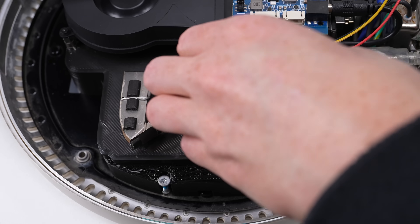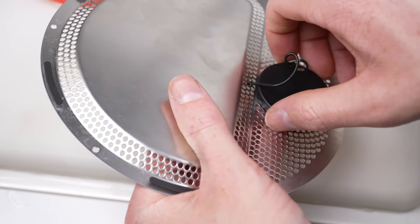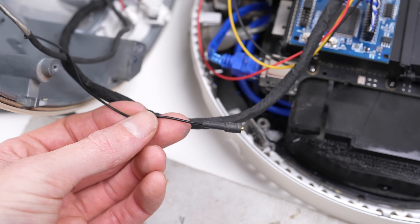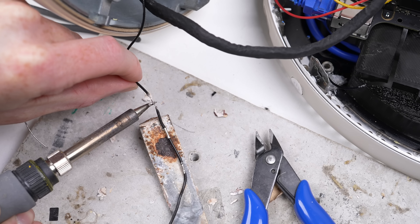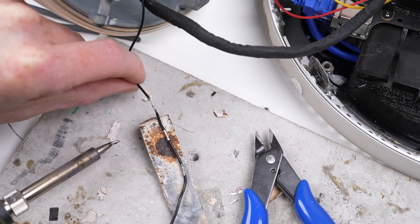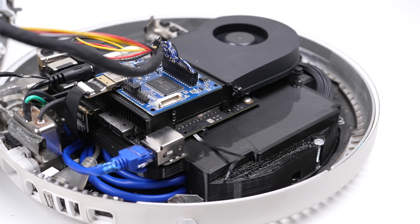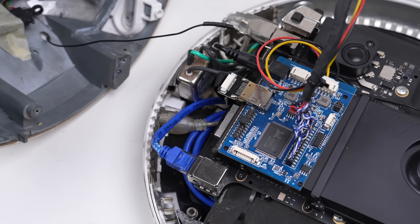The Wi-Fi antenna proved not so easy to remove. I thought it was screwed into place, however it turns out it was riveted - when I pried it apart it tore the cable right off. But fear not, the iMac has one built-in antenna, however the plug differs from what's on the Mac Mini. I can cut the old connector off and solder on the cable from the Mac Mini Wi-Fi antenna. Once it's attached, this completes the Mac Mini conversion.